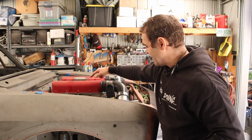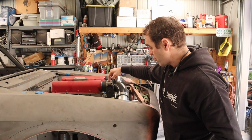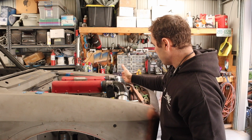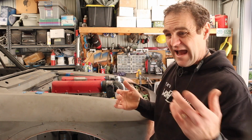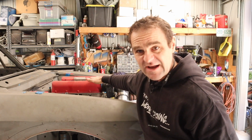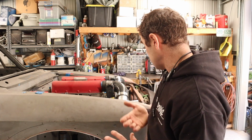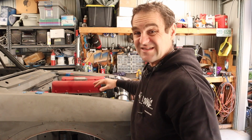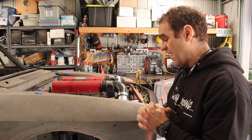So with the bonnet off, you can see that we've got the factory plenums, which I'm going to keep, and it comes into the throttle bodies, and then I need to be able to get the air in around. So it extends these throttle bodies so far forward at such a height that I had to make this bulge quite big and steep to cover all this in. And when I first looked at the line of the Ferrari engine in the car, when I cut the manifold down, I thought it actually fit quite well, and it actually does. But by the time you add clearance for the bulge and everything else to it, it starts getting just excessively high, and I have been racking my brain for quite a while about how to rectify it.